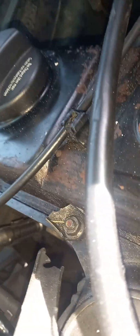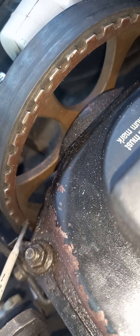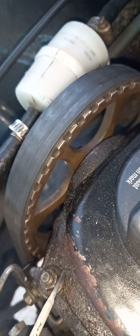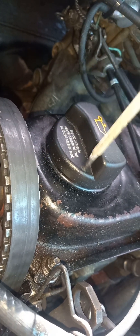Your cam lobes must be facing upwards. On the cam you'll be able to see there's another notch cut out there, and that must be in line with your tappet cover. You'll also be able to see the OT mark on the other side, which must be facing upwards. That's how your crank and camshaft are confirmed on TDC.